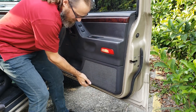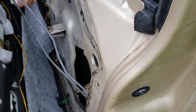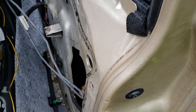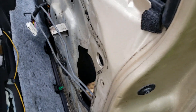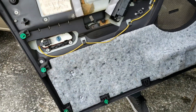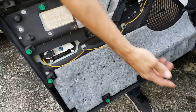And then the rest of it just pops off, just like that. These guys here - pop that tab off, pull the bar up. Swing this tab out of the way, slide the bar up. There's one more plug over here, just pushing the little button on it. You can see all these green tabs here - this one's broke, it's all bent over so that one wasn't doing anything. That's what's holding the door panel on.